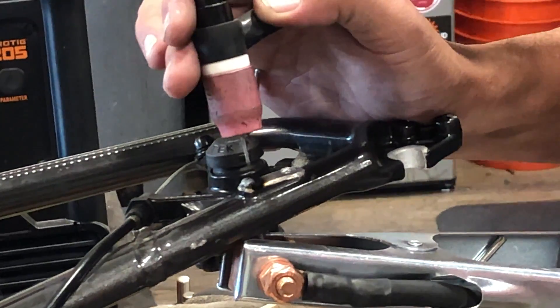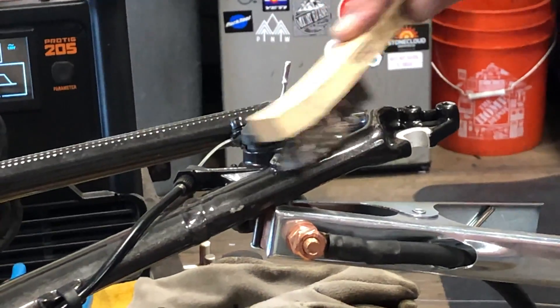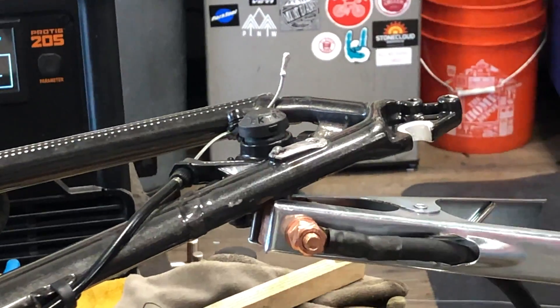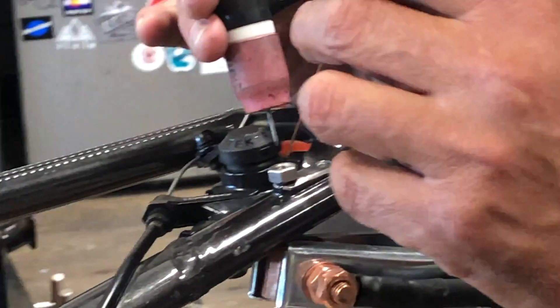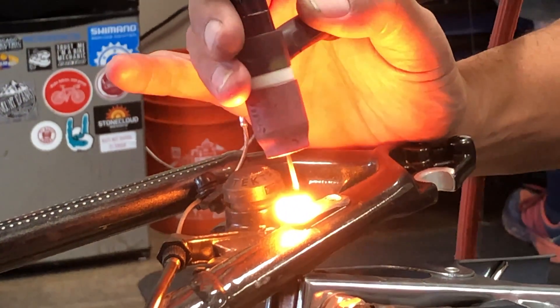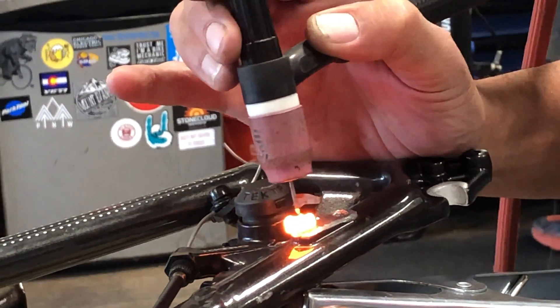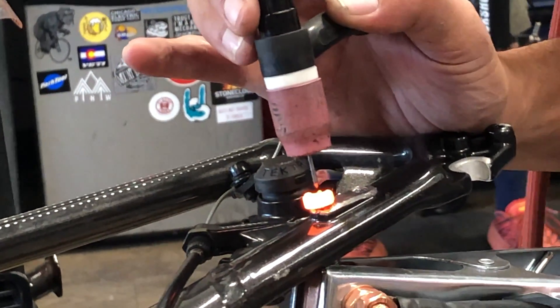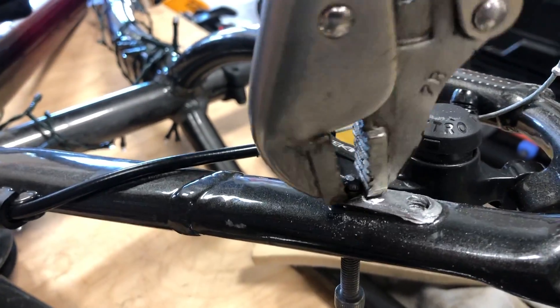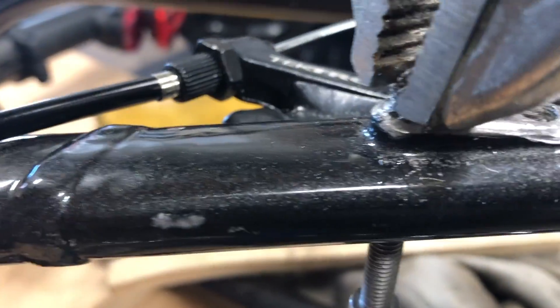I cleaned it up and tried to redo it again with the nut over it. I've done this numerous times and had pretty good luck welding the nut on — normally it helps if you can thread the nut on a thread or two just to hold it in place and get good fusion with the nut to the bolt. In this case I just couldn't get a good fusion, so this attempt basically moved the bolt a little and then it broke off. But there was enough metal sticking out that I was able to clamp my vice grips on and it came right out.